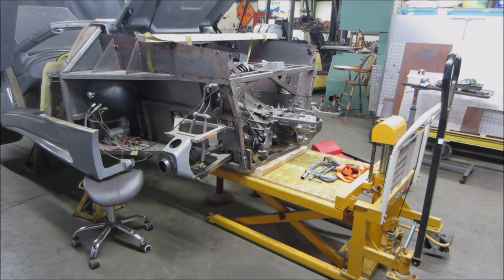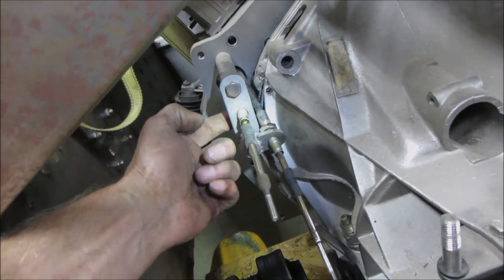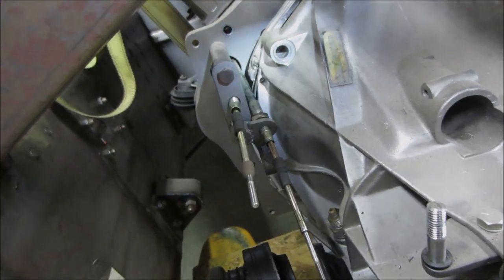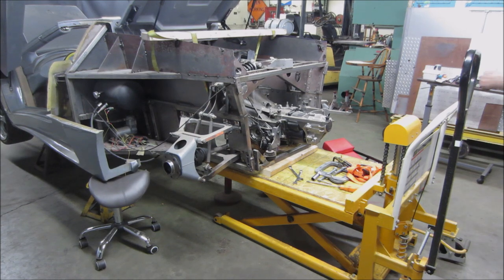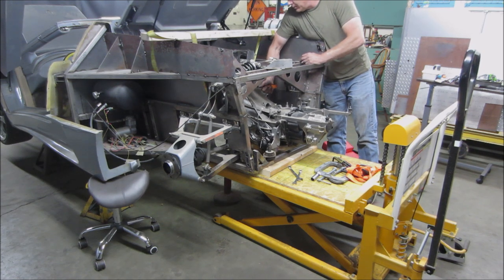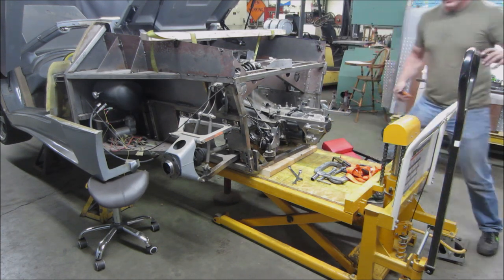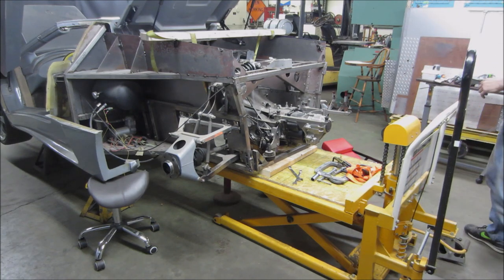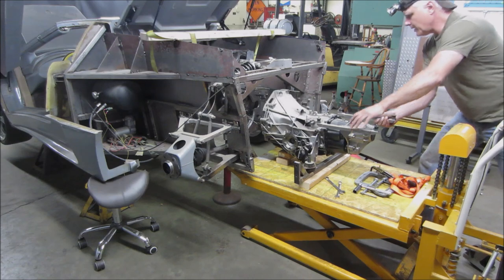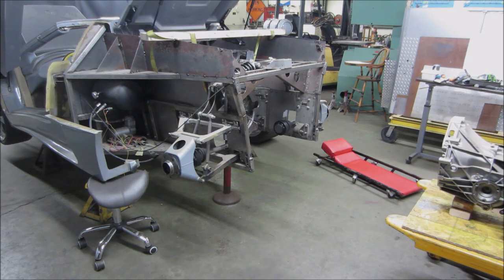There's a bushing on the shifter that's holding. I unbolted the cables so they can pull through. That nut is hitting on the back of that bracket. So you undo this, should be able to lift that up out of the way. But the cable's what's holding this now. If this goes on any longer, I'm gonna need a nap. Just saying. That was simple. And it came apart like we thought it first would.